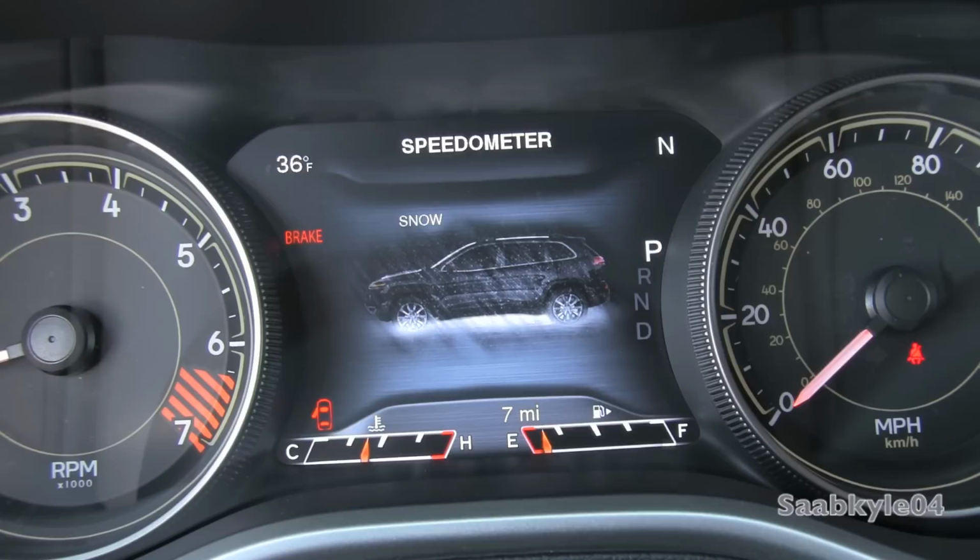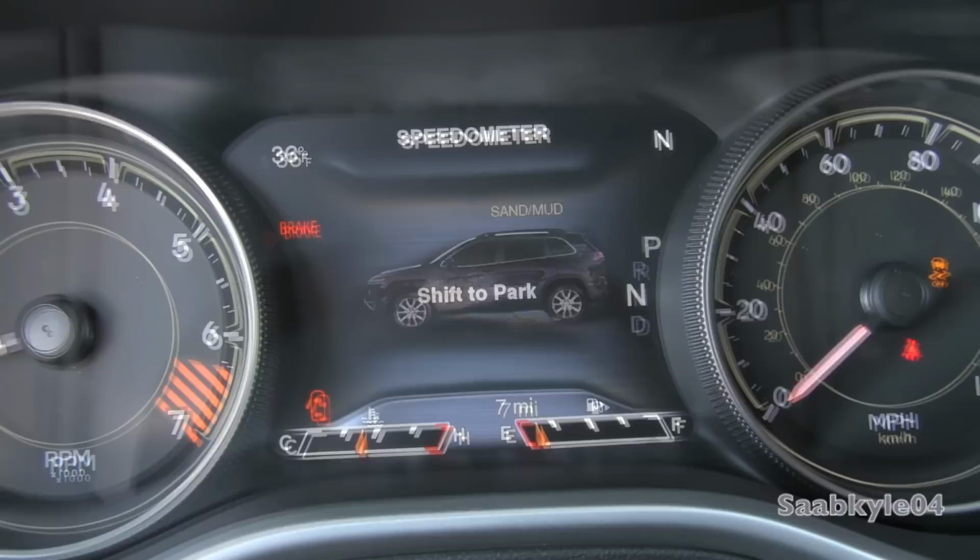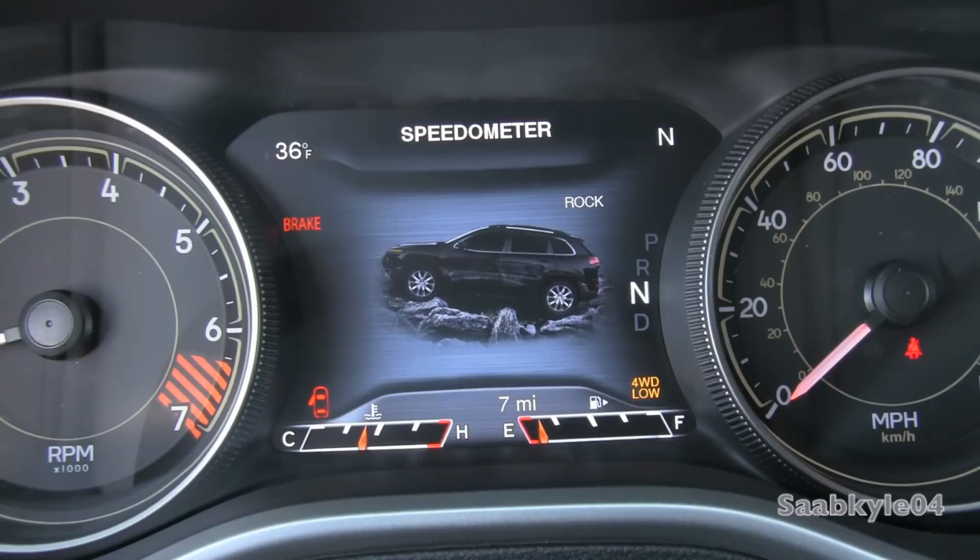In addition to select speed, there's also a hill descent control system which has a similar concept but executed in a different way. Hill descent uses vehicle stability control by modifying torque and brake pressure to keep constant speed down steeper grades. HDC also has only 5 speeds versus 9 for select speed.